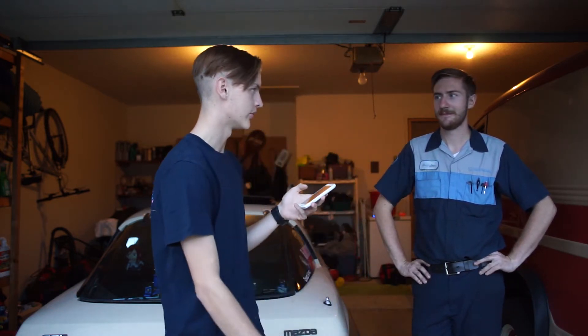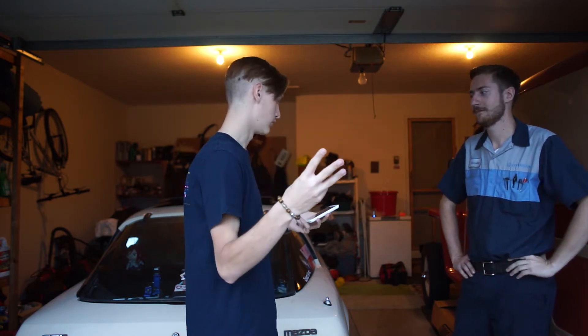Just don't look under the car right now. Make sure the battery is secured, check engine and trans are secure. Suspension, wheel bearings, ball joints, tie rods — we've gone over that a couple times when we've been underneath the car. Brakes — that's what we're working on tonight. Make sure your pedal pressure is firm; we nearly messed that up last time and had to re-bleed it three times to get all the air out. Make sure your fluid level is okay.